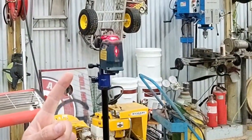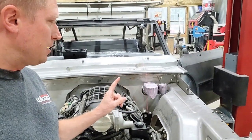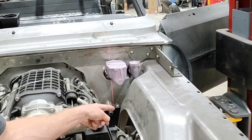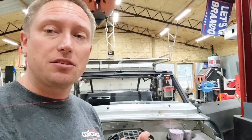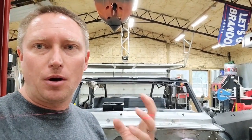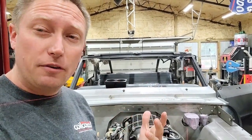The very first thing I want to tell you is that owning a laser that will draw a vertical line for you on the car from anywhere is incredibly important. If you have a look at my firewall, you can see that I've got my laser set up to draw a red line right down the very side of my steering column. The steering column is kind of like a constant in mathematics — it ain't going nowhere. It has to be straight with the car, centered at the proper mounting spot in the dash. So you know you're going to have to mount your master cylinders there and set your spacing off of your steering column.